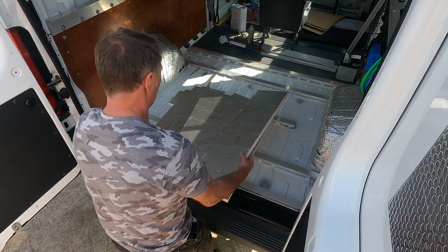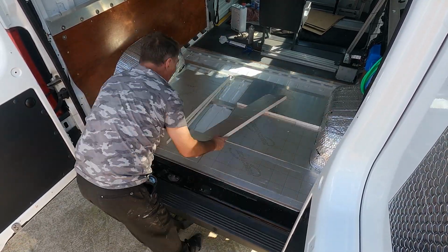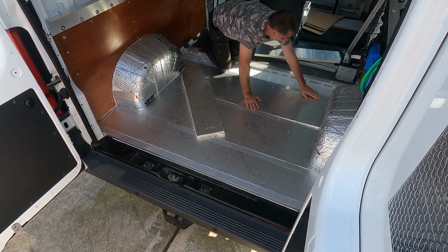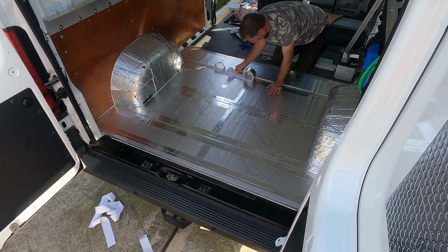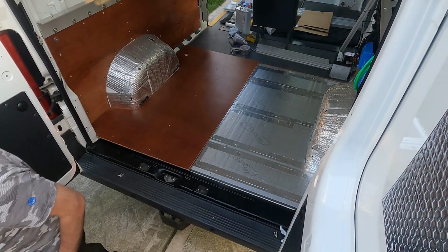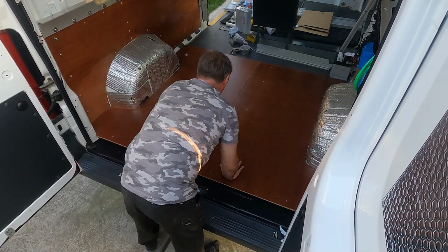With all the beams secured, I can now reinstall my pre-cut insulation and fix and seal with foil tape. My ply flooring has been pre-drilled and varnished. This is only a thin 9mm ply floor, as it's my beams and units that will be supporting all the weight in this garage.